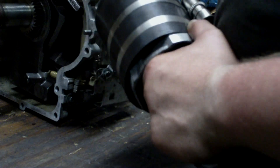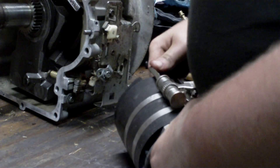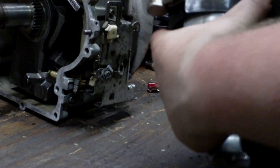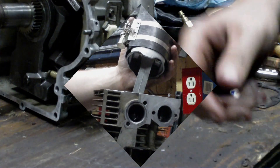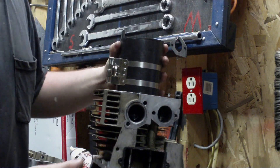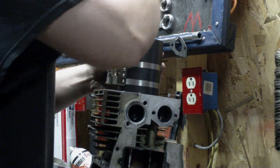You want to hold your piston like this. Start tightening your ring compressor up. Get it real good and tight. Now let's drop it in the cylinder — get ready to catch it down here. Start the piston like this. Take your rubber hammer with the wooden hammer handle. Okay, we've got the piston back in here.